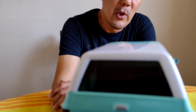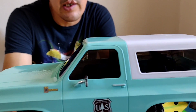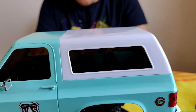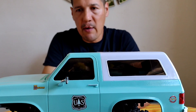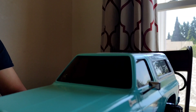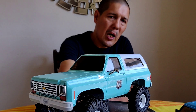The vehicle is pretty much as-is since we got it. The only issue was we had to wait on a new ESC because the first one burnt out and wouldn't run the motor. We ordered a motor and ESC combo, tested the motor, and realized it was actually the ESC connector where the motor plugs in that had burnt out or short-circuited at some point. We got that all taken care of and everything is now functioning.